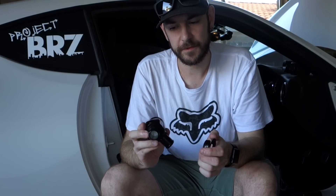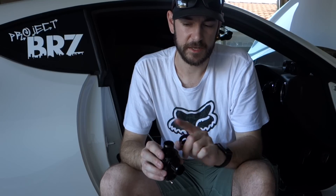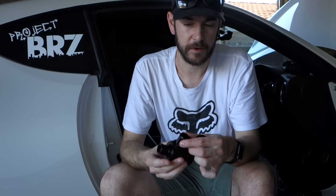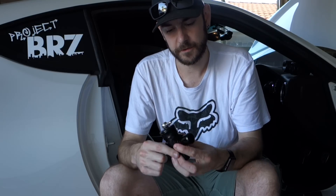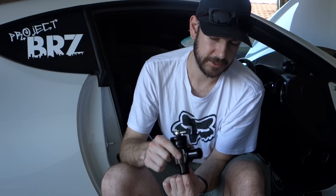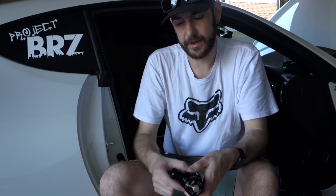Let's have a look at the actual blow-off valve itself. This one I'm running is a TurboSmart compact 25mm valve - what that 25mm means is that the inlet and outlet is a 25mm piece of pipe. There are different sizes depending on what kind of car it's being fitted to and the kind of boost you want to run. If you're running a lot more boost you obviously need wider diameter pipes, but TurboSmart or any other company will be able to tell you what kind of valve you need for your car. The pressurized side - the intake side - is sitting on the pipe, so the pressure from the supercharger is pushing that way. That's the vacuum nipple there where your vacuum line connects, and then there's the spring sitting in there.